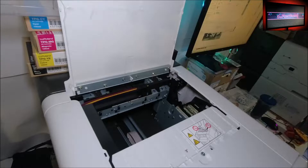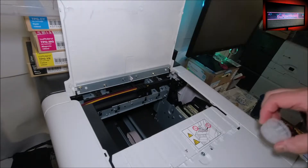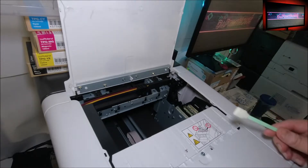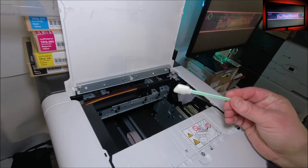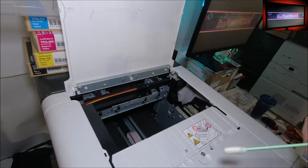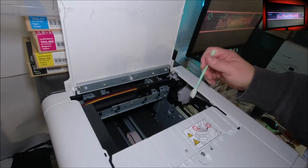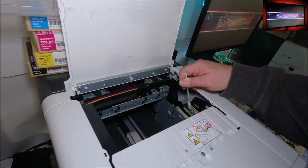So we're up here and you can see the ink station. You really want to wear gloves - I didn't have my latex gloves handy, but the only thing I'm going to be touching today is this applicator. This chemical they say is pretty harmful, I don't touch it either way. These are the stations you're gonna clean - these ink cap stations and the wiper.